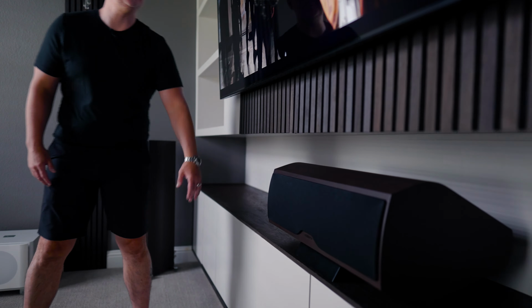We've wire managed it the best that we could, coiling everything up and things like that. But you know, with Control 4 control in here and all of that stuff, the cabinets never even need to be opened. We've got the Rel Airship right there, the super fancy Rel wireless kit that actually works. It allows us to utilize their speak-on cable instead of the LFE to actually calibrate these subs musically with the speakers. Most wireless sub kits are just transferring LFE information, so that allows you to do a little more with it.